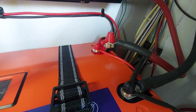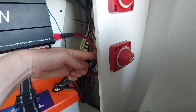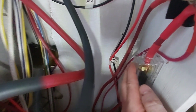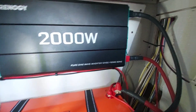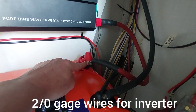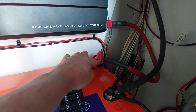So that's the solar: solar comes in here on 10-gauge wire, battery on 6-gauge wire. That goes over here to the bottom switch, through a 40-amp fuse. The original battery out on the tray did not have a fuse, but I went ahead and put this in. We have six-gauge going down to the battery connection, and then from there it goes to a gauge. Then there's the inverter — positive and negative to the battery — and this is a 200-amp terminal block fuse. That's the only thing going to the 200-amp fuse.